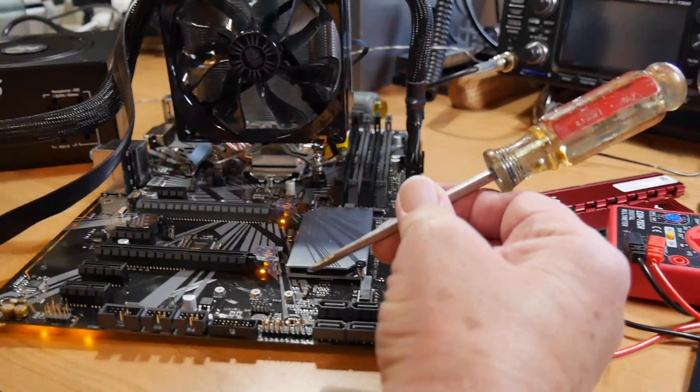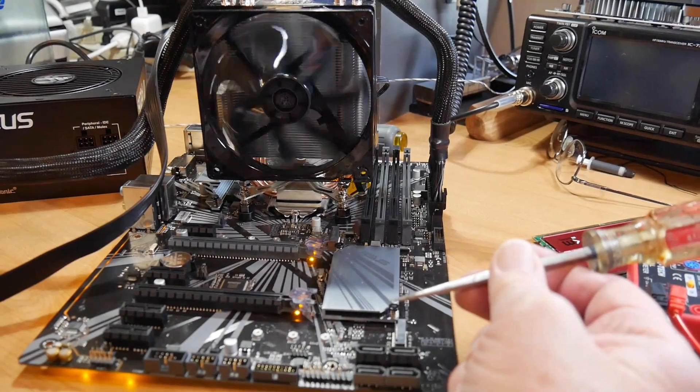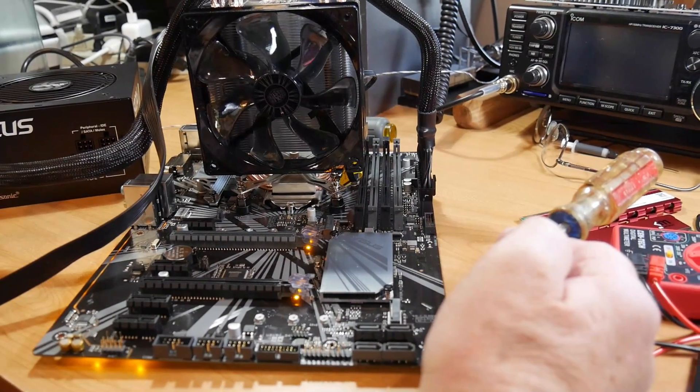Here is what I did with the computer after it was all the way assembled. Let me show you first the symptom. There are no other symptoms, just one symptom. My wife took the picture here. When I touch the little prongs that should turn the computer on, you get little bursts of power to the fan in the CPU cooler, and a little burst on the fan in the power supply, and then it shuts off. The motherboard does have some lights on it — those outline its audio path — and they are on all the time if the power supply is switched on, even when the computer itself is switched off.